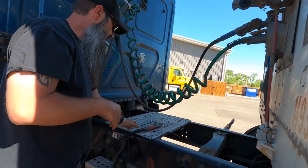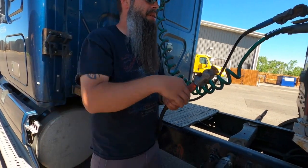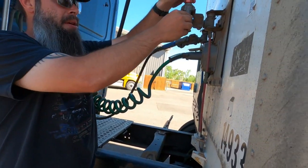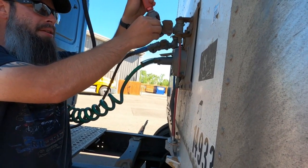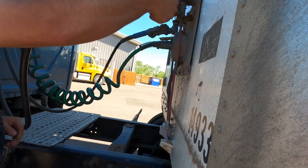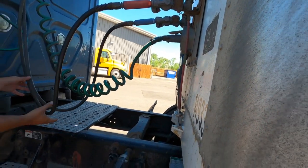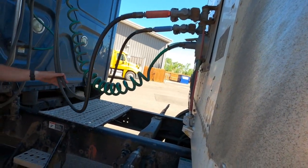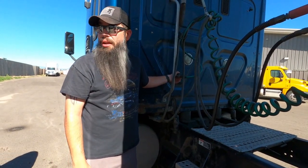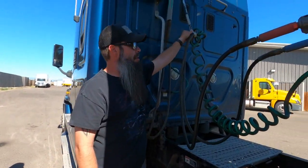So got my service line there connected. Now I'm going to take my emergency line. Again, checking my rubber grommets here, checking this as well. Same thing, I'm going to match up the O-rings here, making sure that they're seated together, and then I'm just going to bring it down, all right? Again, checking the alignment of everything, making sure that it's good. In this case, they're free. I'm going to check to make sure they're not hanging down too low. I'm going to check the tractor side to make sure that they're connected. My electrical cord and safety latch is there as well, okay? I think we're all right. It's tethered up here good.